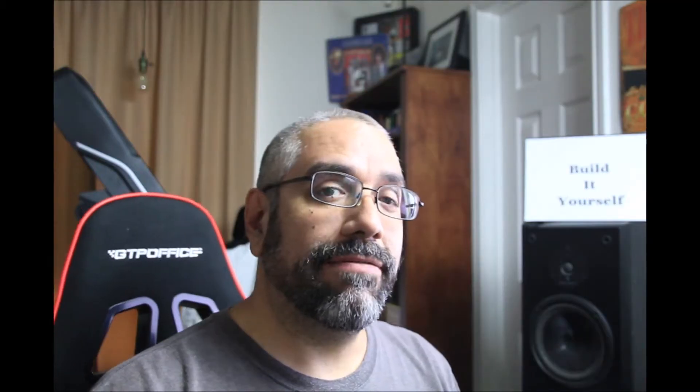What I did was I actually created a few of my own lines — some of the actual cables that go from one side of the vehicle to the other. I bought a crimper, crimped my own stuff, and put heat shrink on them. A couple I already purchased — the black one going to the actual head I purchased, and the red one going to the battery I purchased — but the other ones I created myself. It makes it a little easier when you're doing customization like that. If you have any questions go ahead and post them down below, and as always, if I can save you a few bucks I will.